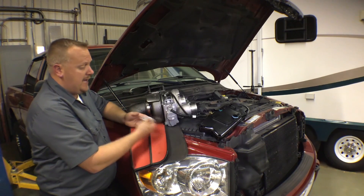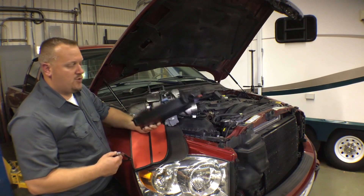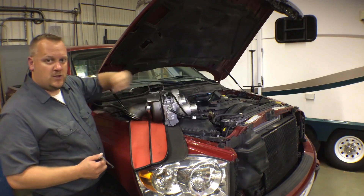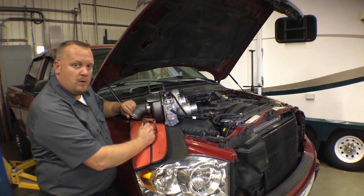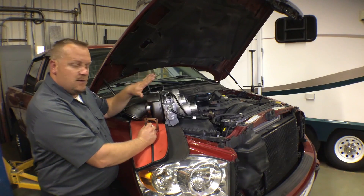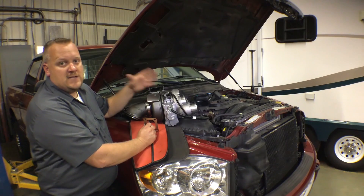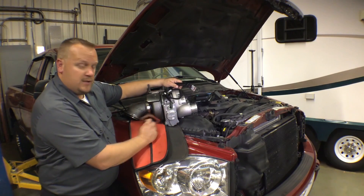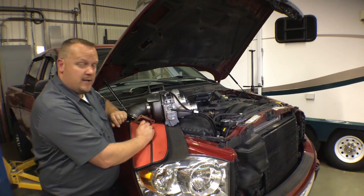We've got our new turbo here. The turbo came with the gaskets, seals, and everything we need to install it. We're also going to recommend going ahead and replacing the crankcase breather assembly, mounted up underneath the valve cover. Anytime we replace a turbo it's a good idea to replace any associated filters or breather assemblies — we want this thing to be breathing good clean air. Also, we want to make sure we've got good oil feed, a good oil drain, and clean coolant passageways, since this is a lubricated and cooled turbo by both oil and coolant. This turbo comes with the new actuator, already calibrated to work with this turbo, and it's got a brand new speed sensor on it. So this thing is really ready to go.